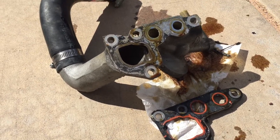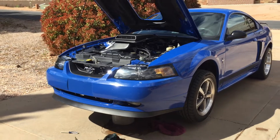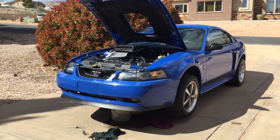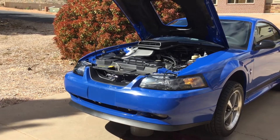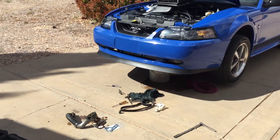This car I bought with 75,000 miles on it in 2011, and it's only at 85,000 now. I only put about a thousand miles a year on it, so it's been a small little drip — here and there, it really hasn't been a big problem. I've been adding distilled water as I go, so most of the coolant that came out was just distilled water. Anyway, it was time for a coolant flush and time to change this gasket.